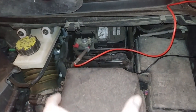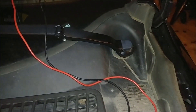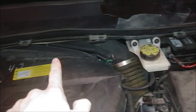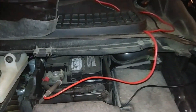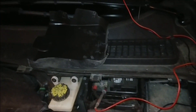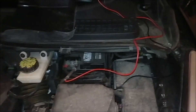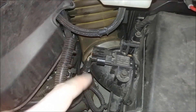Eventually you get all that out and can slide the battery out this way. Or alternatively, remove the windshield wipers, unbolt this, and pull these little clips out that run along here. Then this top assembly comes off — there are some screws back there too — and that makes the whole section come off, which lets you get to the battery and pull it straight out. That's significantly easier, so that's the route I'm going. I don't have to undo all the hose clamps and get it all sealed back up.